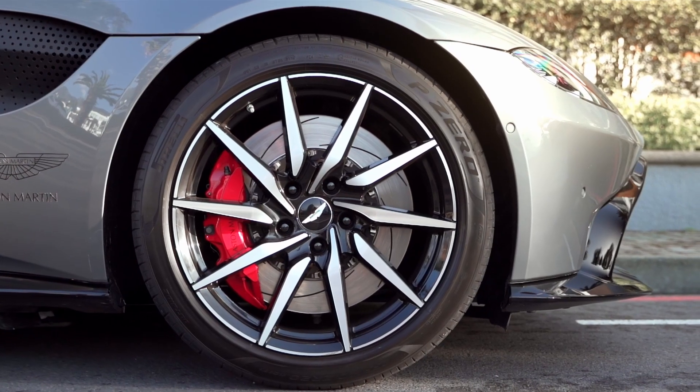You can simply use your fingers and twist the adjustment knob to make it tighter or to loosen it — easy to do on the go, not messy, and it's going to last a long time. It might be true for cars that disc brakes are more efficient, but for scooters, if you can stop both wheels with the brake handles, that's good enough. And you are going at speeds of 50 to 60 kilometers per hour, so drum brakes are definitely sufficient.